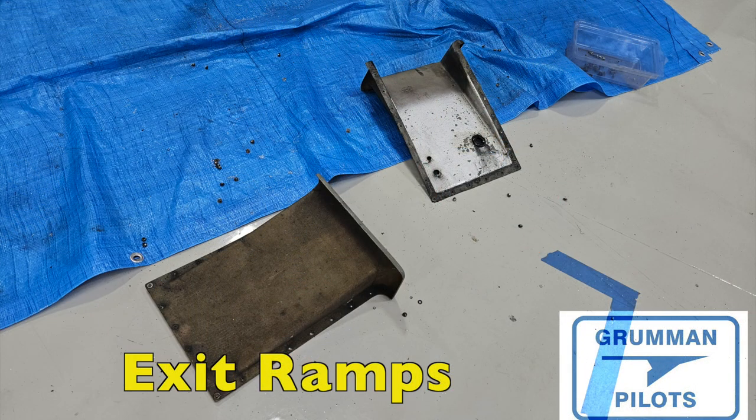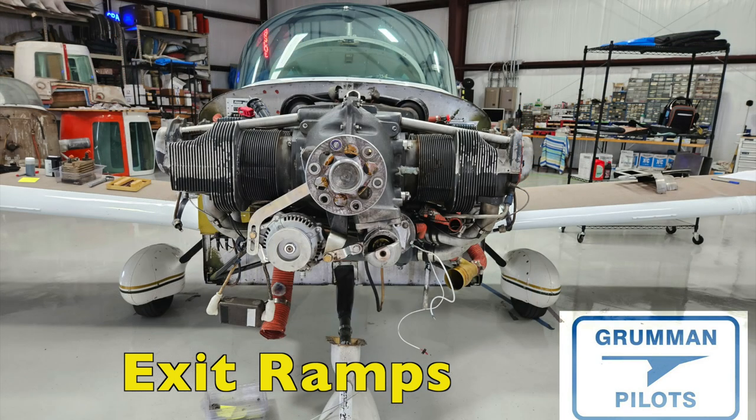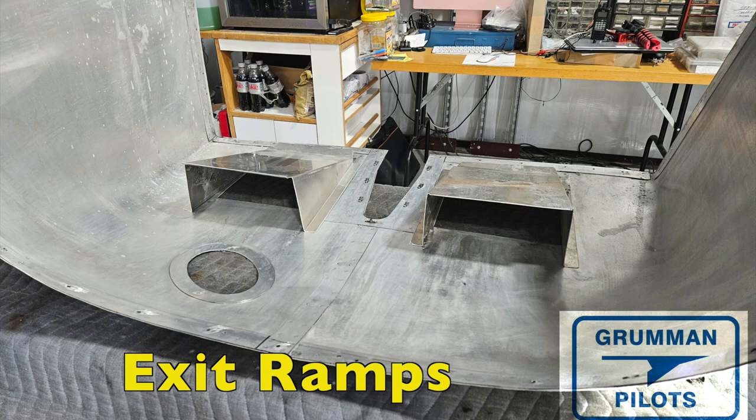This 1976 Tiger was equipped with the original fiberglass air exit ramps, which had been heated, gotten soft, and flexed down over the years. So we're adding the larger Bob Stewart-style air exit ramps out of aluminum, which gives more exhaust area and better engine cooling. The basic procedure: take the old ramps off, get the new ones in place, mark them, drill them, prep everything with alodine, prime, paint, and then rivet it all back together. Here are the new air exit ramps sitting on top of their opening, getting ready to be marked so everything can be match-drilled for re-riveting.